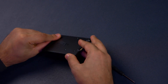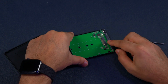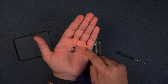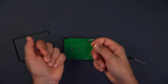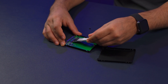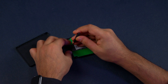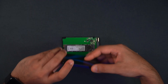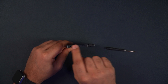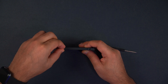To install the SSD into this adapter, pull on the plastic tab to reveal the connector. Open up the bag of screws and use the larger one to install the SSD — grab your SSD, place it in the connector at a 45 degree angle, push in, then using the included screwdriver screw the SSD into the adapter. Close it all up making sure the connector is lined up with the cutout, then screw in the four smaller screws into the screw holes.